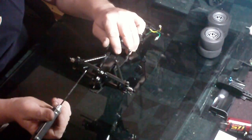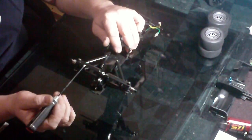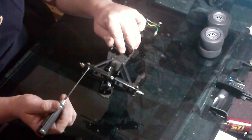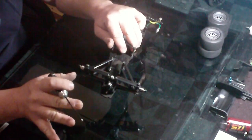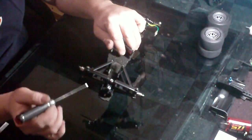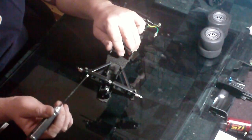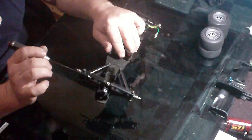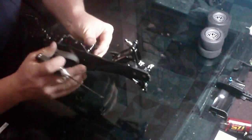So what you're trying to do is, again, you can almost use the height of the arm, and by that also the outer arm, to sort of set the level of aggression of the car, and then use the static camber to sort of set how much overall steering feel it's going to have. So I think that would be a good plan to let the car have the amount of steering it needs to be fast, but at the same time not make the car bananas, not make the car too hard to drive.